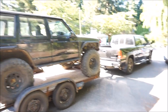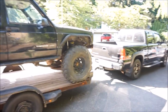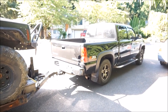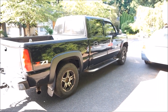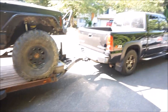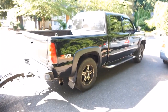I've got the truck all loaded down with my Jeep up on the trailer — I estimate about 5,500 pounds — getting ready for a weekend trip towing over a mountain pass. All I did was pump up the airbags; I put about 45 psi in them. There's no real science to it — I just kept adding air and checking, looking for the truck to sit level. And if you notice, it is looking nice and level, just like it does at ride height when it's not loaded. Before, it was squatting pretty badly. I'm also looking for a nice level trailer. I think it's just experience — learning how much psi to put in — but already that ride height is just about perfect.